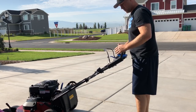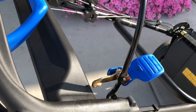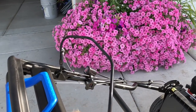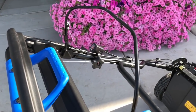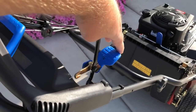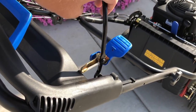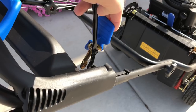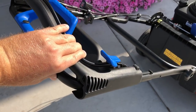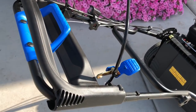This mower has a blade stop feature — when you release the mowing handle, it actually disengages the blade but doesn't turn the mower all the way off. To engage it, take this handle right here; it has a stopping action that won't let you pull it. All you have to do is flip it up like that, and then it will let it engage and the blades will be engaged. Kind of a fun little feature.